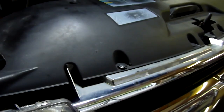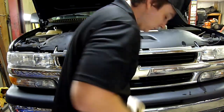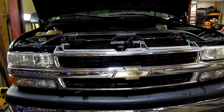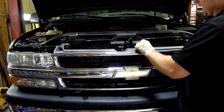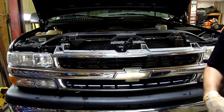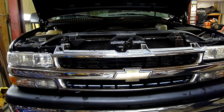The first step to removing the grill is to remove the little radiator cover using a panel clip removal tool or a flathead screwdriver. Removing the front grill is really easy. You're going to have a couple of mounting locations up top that you'll just twist-lock off. So you twist-lock this one and this one, then grab your 10-millimeter and remove this remaining bolt. Then you'll have two more Phillips head screwdriver style little clips that hold in the rest of the grill.